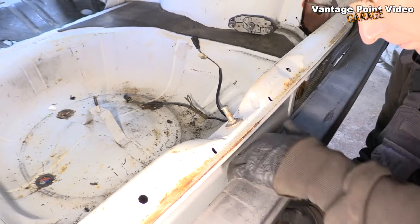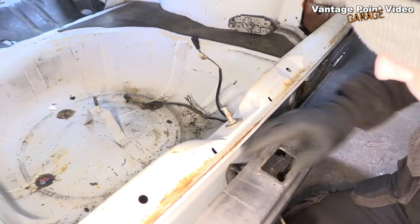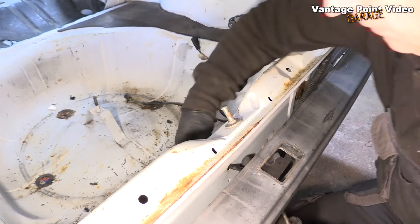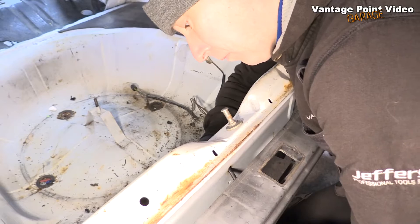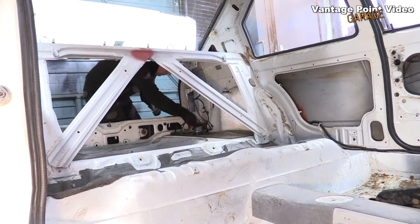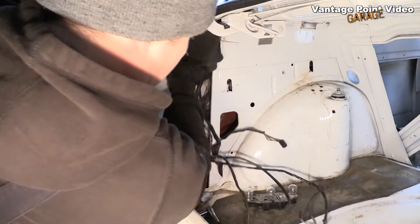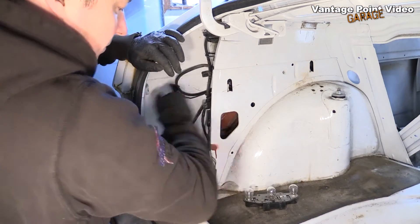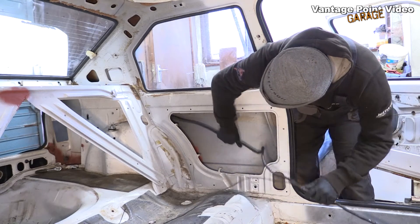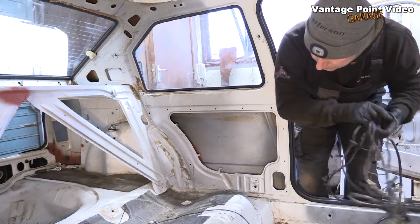There's a little grommet that's a bit awkward to do with the bumper still in place. Got one edge through already, and I use a screwdriver to poke the bottom. Then that'll feed back through. With the earth removed at this side I can pull out all the rest of the wiring — it shoves up into this area of the quarter panel. Now I have to get all the ends past, then I should just be able to pull it all through. All in one go.